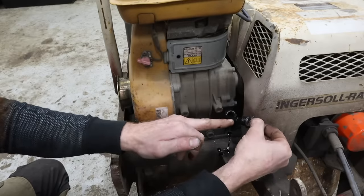Beyond that, we found a hydraulic leak, we found some broken lines, we found some loose fittings. I do know that, for instance, this throttle, or this forward reverse mechanism, it's all free all the way through the cable. But the throttle barely moves. And so I've been soaking some penetrating oil down the cable. There's this spot on the cable here that's like bulged. And so I don't know if maybe the wire got out of the actual sleeve and bound up in there. It will not go all the way to idling. It's definitely not making its full travel. And when I look here, which is where it should be showing or moving, this throttle mechanism on the engine doesn't move. So absolutely worst case, we disconnect the throttle there and then we manually operate it until I can figure out a fix or find a replacement.